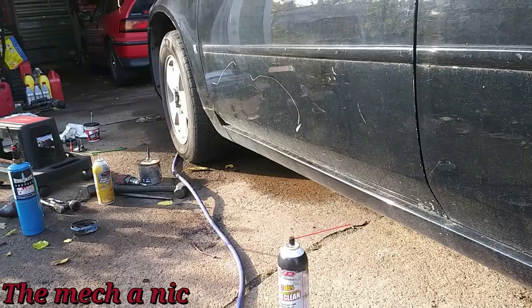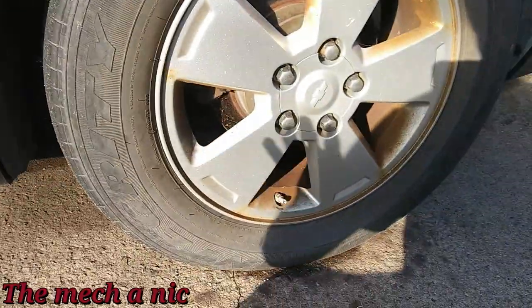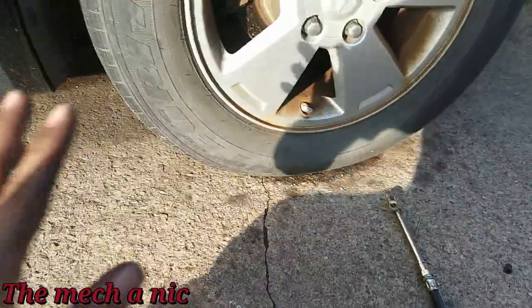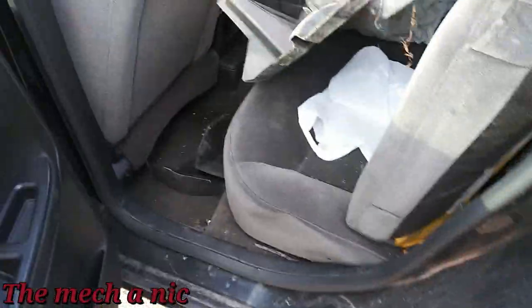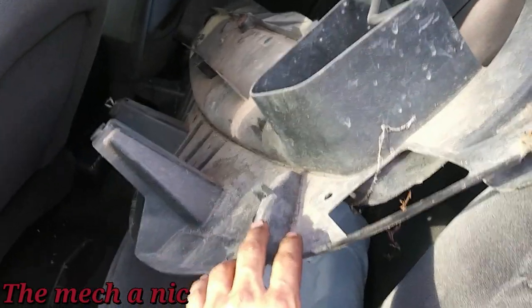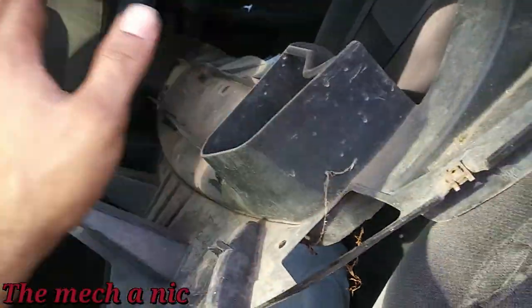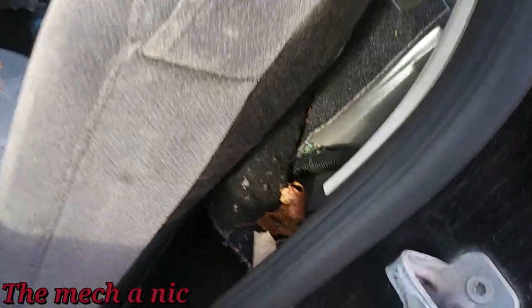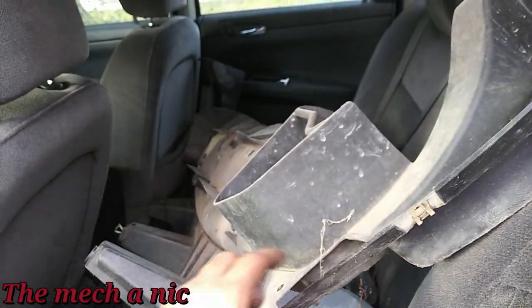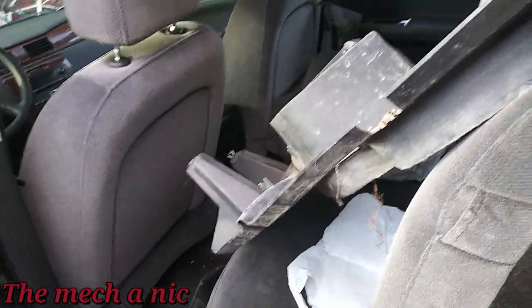All done with the front brakes and the wheel bearing — everything is torqued down. One of the final things I want to do is put some air in these tires because all of them are horribly low — this one has about 10 PSI in it. Done topping off all the tires. I almost forgot about the little shield that goes underneath the front of the car. Some of you are going to say something about me putting this nasty piece inside the interior, but if you saw the interior of this car it doesn't really matter. The owner was here when I took it off and said it was fine to put it inside.